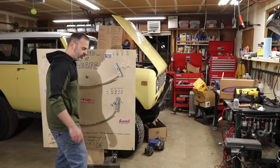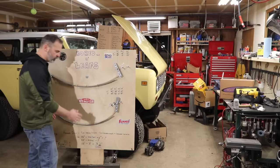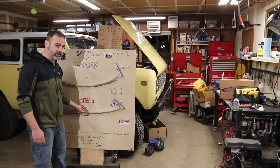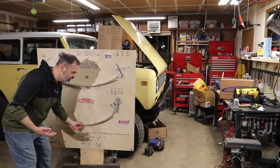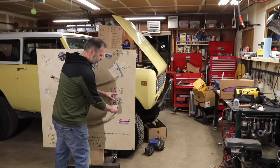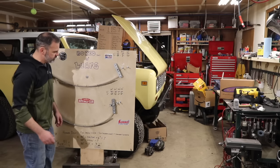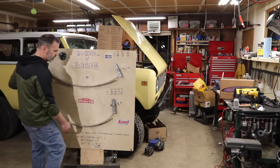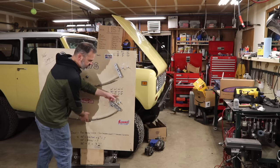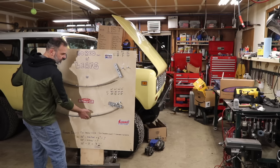Now the same position, 32 inches, with the much more arched spring. At ride height, notice a lot of action. At compression, a lot of action. At droop, some action — not quite as much off the 90-degree angle. That's 12 degrees of compression at 32.5 inches. Moving it in a little closer to 30.5 inches — at compression, big difference: 42 degrees versus 12 degrees, a 30-degree difference. You get a lot of action and a lot of droop.